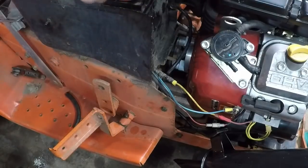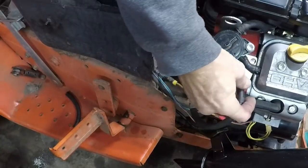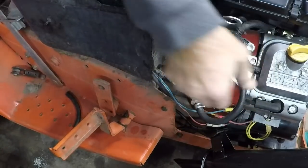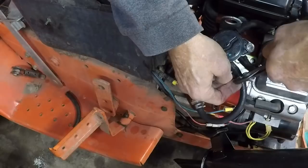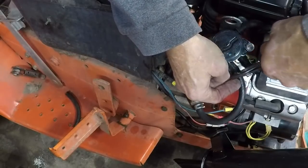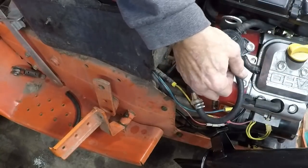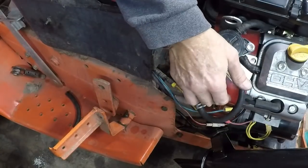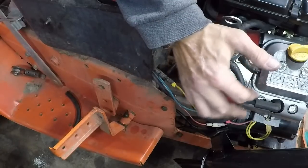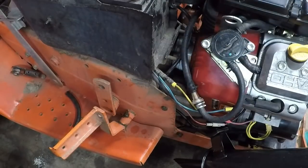But back to the GL. That one cylinder that was down to 50 psi, it may just be stuck rings. It's really hard telling what it is. So after I determined that, I only spent about 30 minutes on it. I'm kind of anxious, you know, it's a new toy. So then I also came out and I pulled all of the drain plugs out of the fuel bowls on the carburetors, and one of them just poured rust out of it. Just a powdery, rusty material. So one carburetor out of the 4 is getting fuel. The rest of them are not getting fuel.